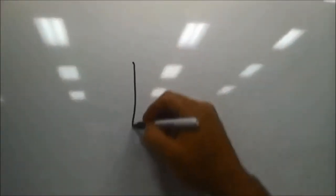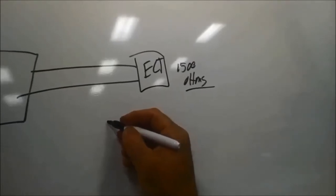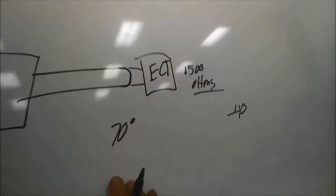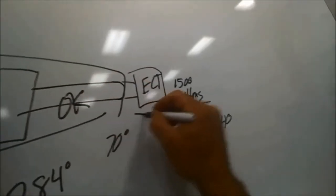Let me go up to the board and demonstrate that real quickly. So basically you have your PCM, you have your wiring, and your sensor, which is your ECT. When everything is hooked up correctly — let's say this is 1500 ohms — that might be 70 degrees. But when I open it like that, the resistance goes very high and it shows negative 40, meaning the computer can detect an open circuit. Now if I jump it like that and it goes to 284 degrees, that means the computer can detect a low resistance circuit, or a completed circuit. So this portion of the circuit is okay — that must be the defective part on the vehicle. That's how you diagnose by simulation an engine coolant temp sensor circuit.